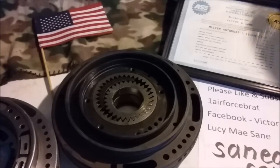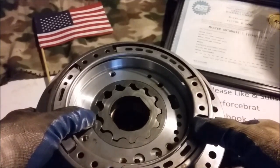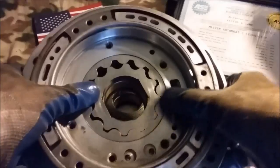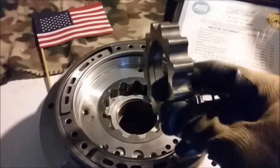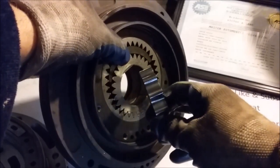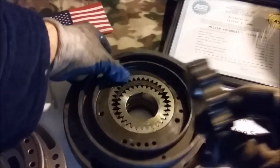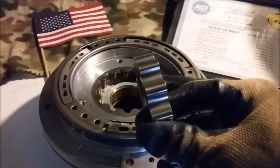There's another change in these aluminum pumps in 2004, and of course the casting number changes. These gears will still be 0.608 thickness, which is different from the earlier gears which were 0.568. Those 0.568 gears went up to 1994, and from 1995 all the way up to 2003 and the 2004 models had these 0.608 thickness gears.